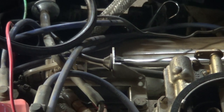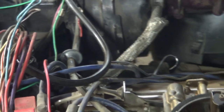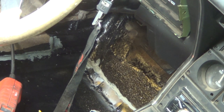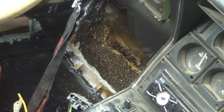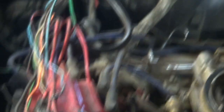I've opened this loom up and followed this blue wire back to the bulkhead connector. The bulkhead connector is under the brake booster — nearly impossible to get to. And inside, down under the dash, that bulkhead connector is behind the fuse box, so that's ridiculously impossible to get to as well. I don't see any evidence that this blue wire has been tampered with anywhere — except here on the end where they cut it off. So it's broken between here and that relay in the cab that we checked with the test light.